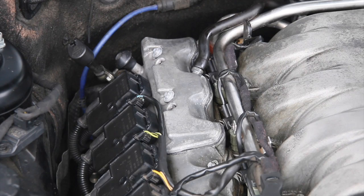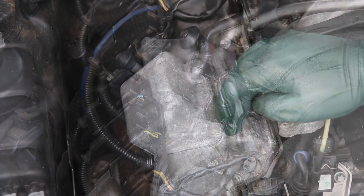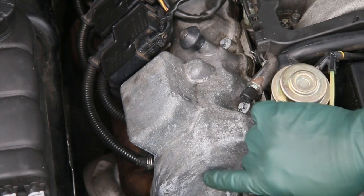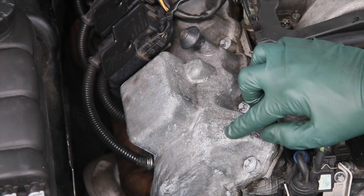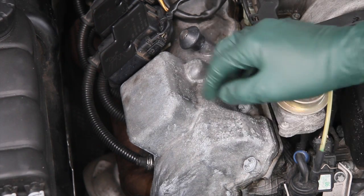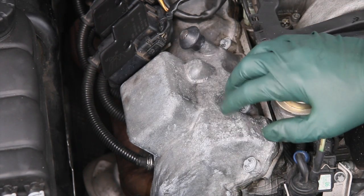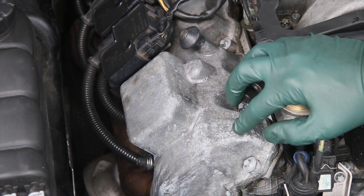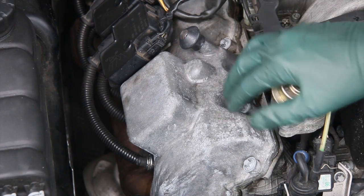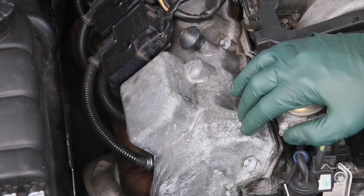Let's talk a little more about this intake manifold because it's looking pretty good. I'm not going to give up on this protective coating, but I'm going to have to find a way to neutralize the corrosion on the magnesium before I apply that top coat. So this is going to be cleaned off again and I'm going to do some research on a couple different types of acid where I can neutralize this corrosion, clean it off thoroughly, then recoat it with the metal protectant, and we'll take a look after a couple months.